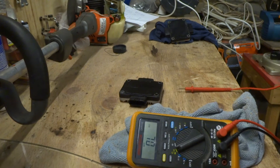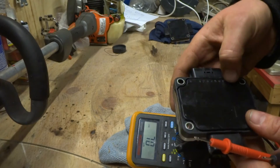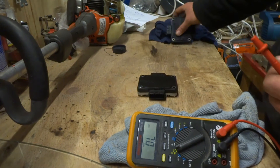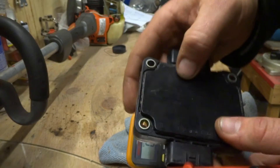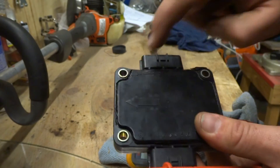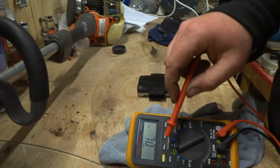Underneath the igniter you'll find a series of numbers, one through to six, then E, and on the other side on some of them it's also marked — you can see on that one there. As I said before, they're just transistors, marked base, collector, and emitter. You basically want to grab your multimeter and set it to resistance.